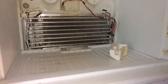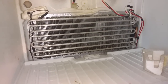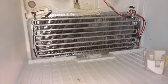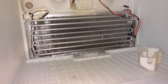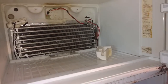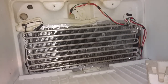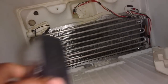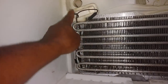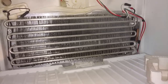The third thing that can happen is the thermostat can go bad — that'll stop it from defrosting properly while it's functioning. Or last but not least, the fan can go bad, which is very rare for that to cause this problem. Because the refrigerator is creating ice, it's normally your heating element or your timer. So the first thing you want to do is take the panel apart, somehow access your heating element, and test that for continuity. Find the two ends of the heating element, put your ohmmeter to ohms, touch one probe on each side of the heating element. If you get a reading, the heating element is good — you probably have a timer or thermostat problem.